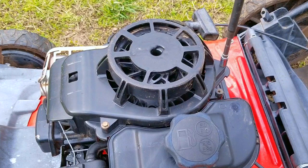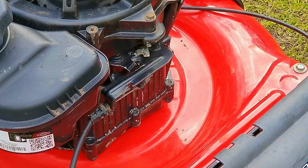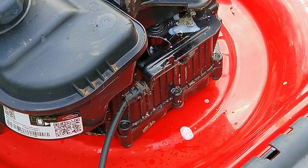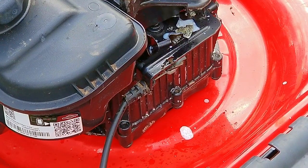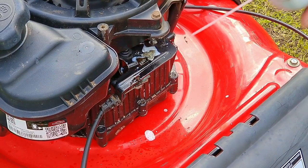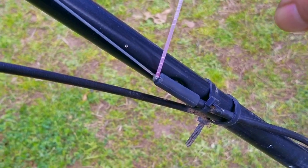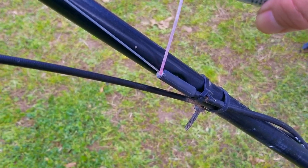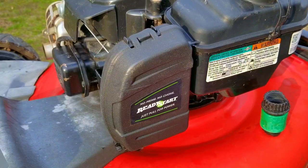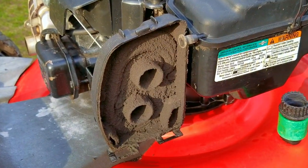This is not necessary, but more than likely it's never been done on this mower before. Before spraying lube on moving parts such as the safety switch, try cleaning off the dirt and old grease from it first — cleaning it will make lubricating it a lot easier. Also, if you're having a hard time using the brake handle, it might be that the cable is getting stuck in the outer plastic of the cable. If you think that might be the issue, I would consider just replacing the cable — they are not that expensive and also very easy to replace.